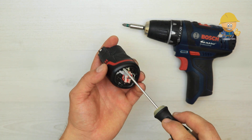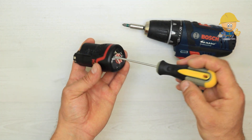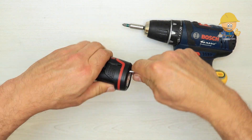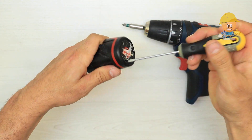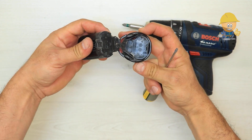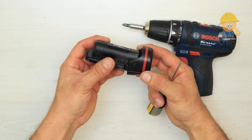To open the battery we use a flathead screwdriver on the three holes. We introduce the screwdriver and press the clamps outward until it sounds like it was disconnected, then pull the lid to remove it. After that we have three more clamps to open the top part, which is the part with the power terminals.